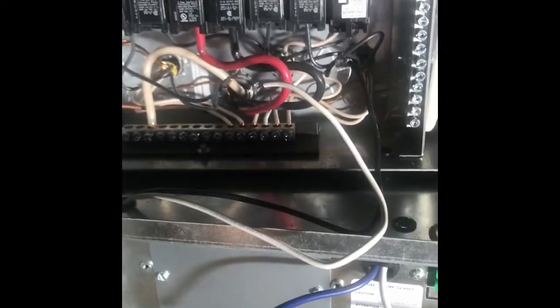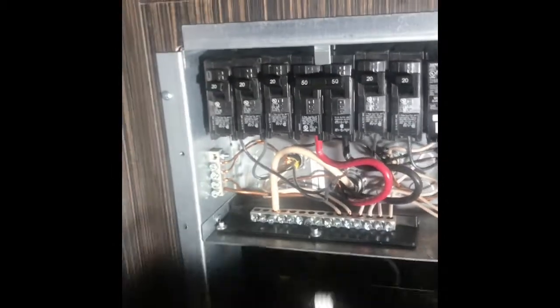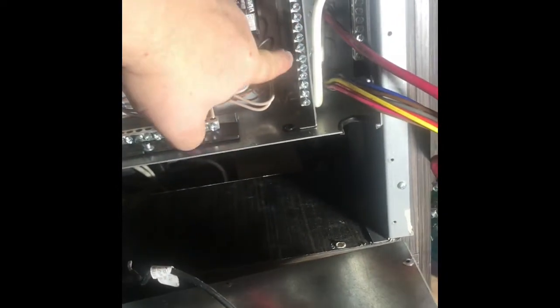And we should have, except for the chassis ground, all of the wires disconnected from the chassis. Now, surprise, surprise, it looks like there are no specific chassis ground wires. So we're going to go ahead and fashion a chassis ground wire using some spare additional wire that I've got, which I'll run to the common ground right over here on one of the additional ones.